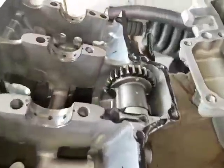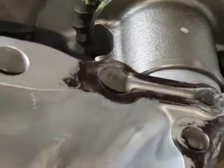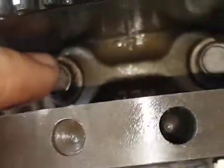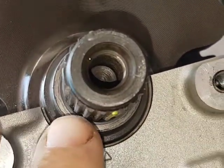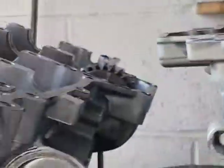I've got this locked and when it's locked you've got this indentation cast in pointing upwards. The two marked cogs I've highlighted with a yellow pen to make them clearer. At about the 9:15 position, the crankshaft - looking at this upside down - is at TDC number one, so the con rod in number four is down same as number one. What you're looking at is this triangle which is lined up with the fifth spline. I've marked that one in yellow from the wide spots: one, two, three, four, five - the fifth spline lines up with that triangle.